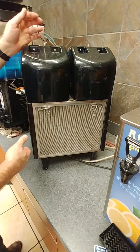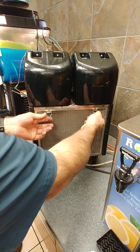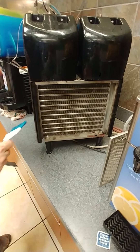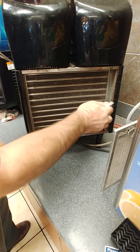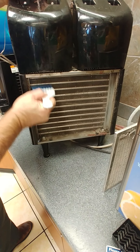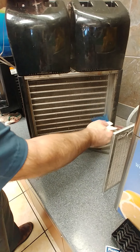On the back of the machine, while it's exposed, we want to take the air filter out and wash it off and reinstall it. Also if the condenser coil is dirty, we want to brush it out — this one has a little debris on it, so just take a brush and brush the excess dirt out of the coil. When it's clean, we'll wash the filter and reinstall it.